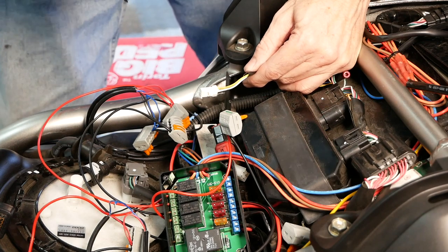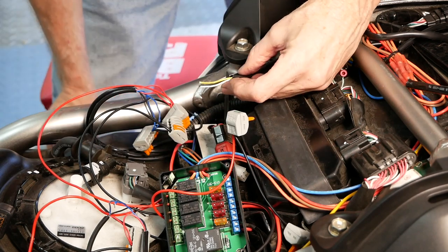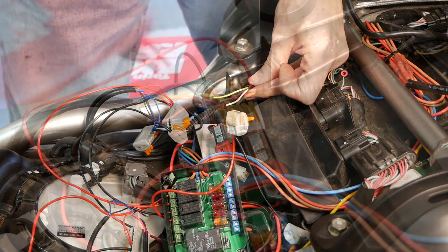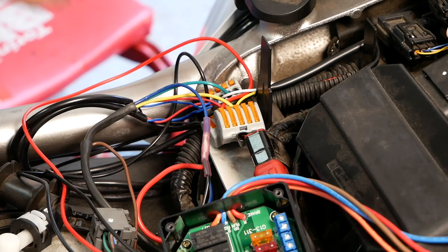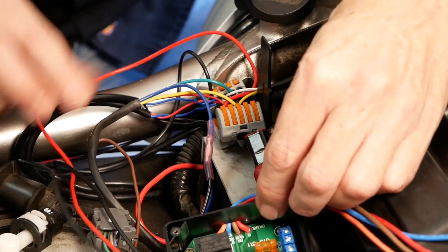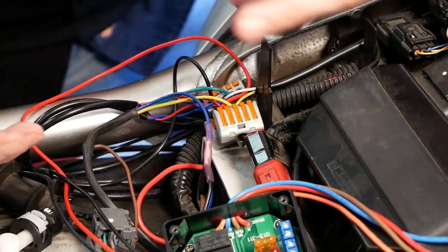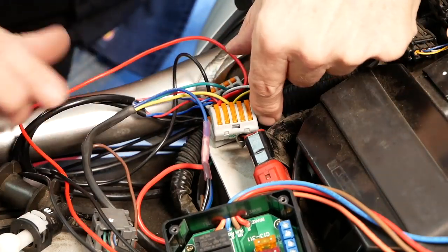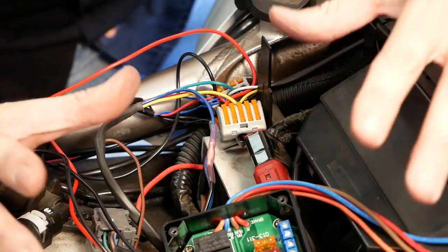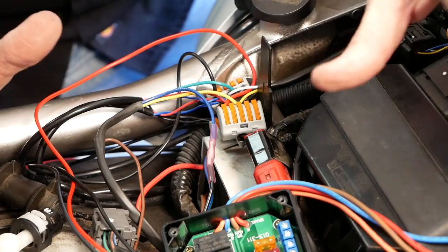The reason we can get away with this on the Goldwing is because almost all of the accessories other than my trailer are LEDs, and LEDs don't pull very much amperage. I'm writing 'GND' on this connector so I know it's the ground, and I'm going to take all the ground wires and plug them into this terminal. I'm now cutting the connectors off the end of the Pathfinder brake tail light wiring harnesses, spreading the wires apart, and stripping them since I won't need their connectors anymore. I made the wires going to the isolator fuse block a little longer so they could reach over to the right side. Now all of my accessory electrical lighting is going through the isolator fuse block and I no longer have to worry about the CAN bus system.